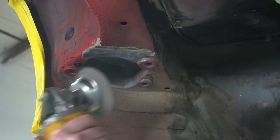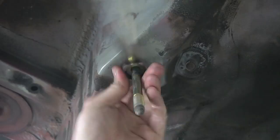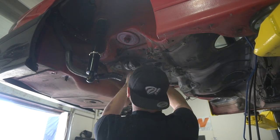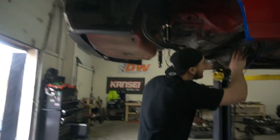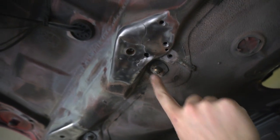The first thing we have to do to prep for all this is to get rid of all the paint and all the seam sealer — everything that's in the way — because we need a nice fresh bare metal surface to weld to. As you can see there is a lot of seam sealer on all this. Some areas are just paint, but then areas like this are gonna be a nightmare. After what feels like an eternity later, it's prepped — no more seam sealer, no more paint. Now you can really see how destroyed this thing is, but we're ready to go.